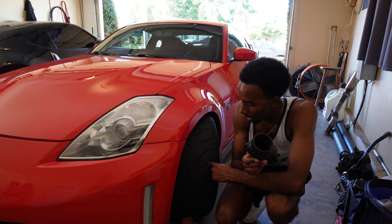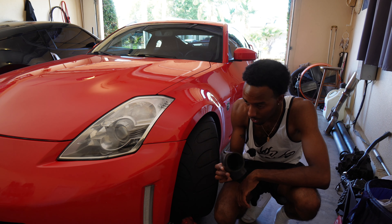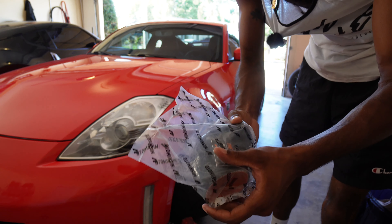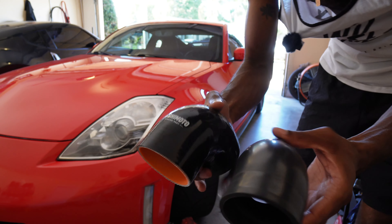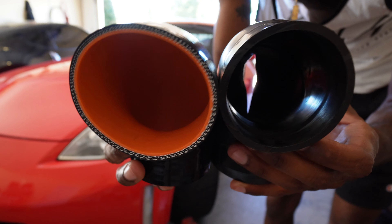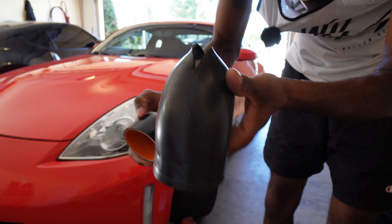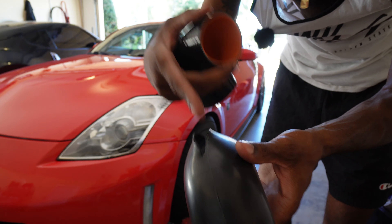The first one happened when I got to my boy's house when we were doing the clutch. I changed it out to this one and it happened again. It's because this is a cheaper style of silicone — a very cheap Chinese one. I am going to be changing this out. The coupler is actually accessible right here with the wheels turned. What I'm going to do is jack the car up, take off the old one — the third one by the way — and we're going to be installing a Mishimoto 2.5-inch to 2.5-inch. This one is a lot thicker quality. You can notice the quality difference right off the bat — the Mishimoto is a lot thicker material and definitely not going to pop like that. Also, it doesn't have the indentation where the cheap one kind of has that line which makes it prone to popping.